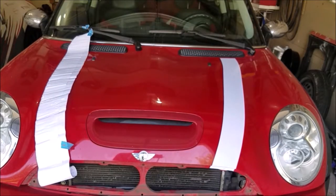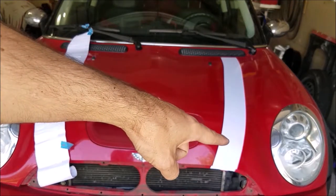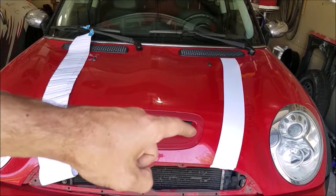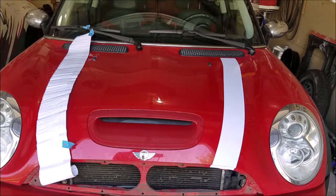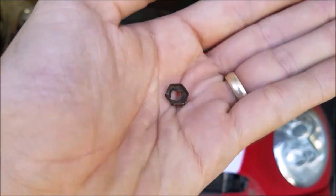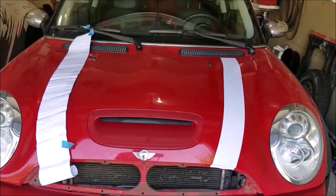The driver's side stripe is on and I'm really happy with how it turned out. I still need to do a small section at the top between the grille piece and the end of the stripe, but I'm happy it covered up a big paint chip at the front of the car. The stripe is maybe an inch off from ideal but no one will be able to tell. Make sure you remove the front grille — once it's off you can wrap the stripe under it, and the adhesive backing plus the pressure of the grille reinstalled will keep it in place long-term. The grille uses 10mm stamped steel nuts that cut threads into plastic posts, so they can be a little difficult to remove.